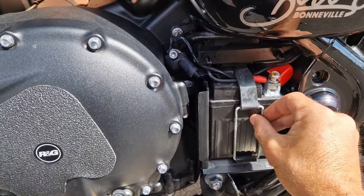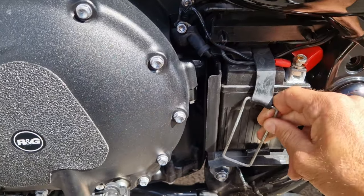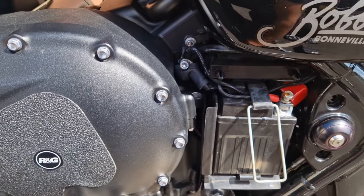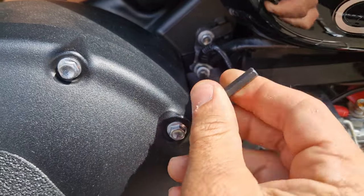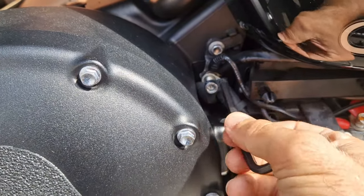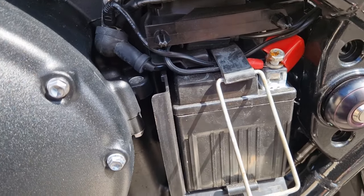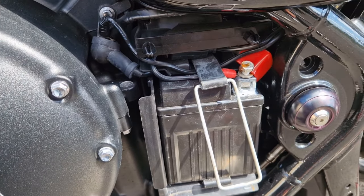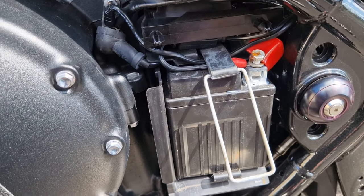To remove the battery itself, grab this little clip - it's quite difficult - push down. Now I'm going to loosen that off using the allen key. I've already started to loosen these off just for the purpose of this video. Take off the negative terminal connection and then undo this screw. As you can see I've already undone mine on the positive terminal - it's quite hard to get in there.